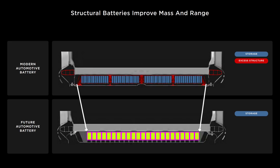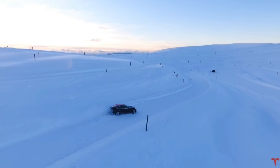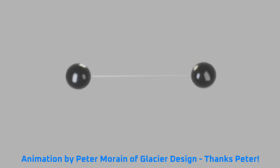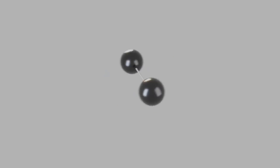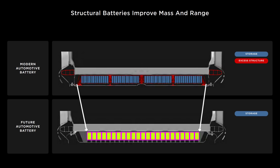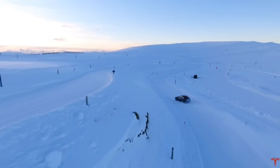Either way, the centre of mass of the battery cells could be clustered more tightly around the core of the vehicle, with no steel structure surround at the perimeter. As Elon said at Battery Day, having the weight tightly held near the core of the vehicle improves the polar moment of inertia. Polar moment of inertia is determined by how tightly the weight of a vehicle is centred around its core — the closer to the core, the easier it is to spin that object. In the case of a car, the spin is the car turning around a corner. Imagine holding milk jugs at arm's length and twisting, versus holding them near your chest. You can twist much more easily near your chest, and the same happens when battery cells are placed closer to the core of the vehicle.